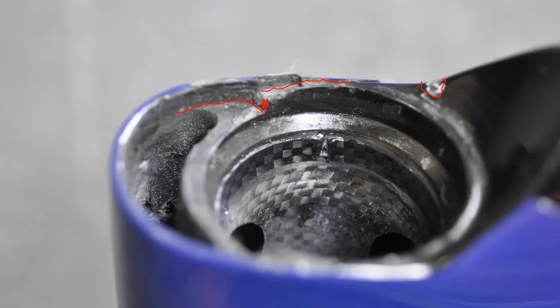So now you'll notice that the full height of the space is there, but it's actually gouged out about halfway. So you're ending up with such a point load in that area, and because of the support of the bearing, which sits in that bearing recess there, that constrains that face. So the only place the material can go is out to the side, which is exactly what's happened.